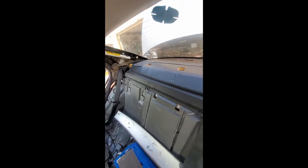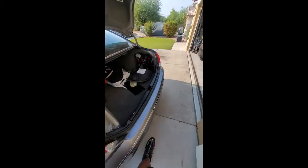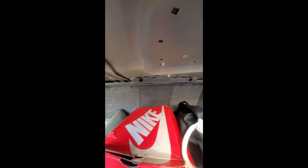Got the speaker grills in. Next step, we'll go to the trunk — we'll screw this piece down from underneath, get those bottom bolts back in, and then start putting up these side pieces before we put this trim on because it clips right here. We can also stick in these anchors. In the trunk, you have these three bolts here and they screw up right here — that's one, two, and the third one is over here. That's what actually holds the sunshade in and stable.